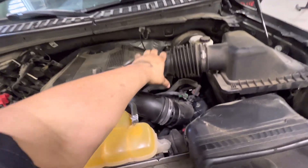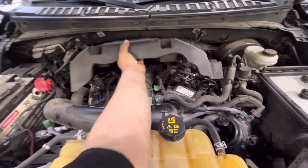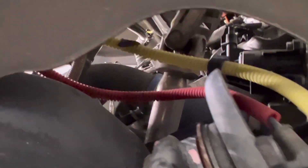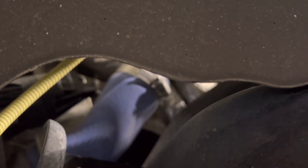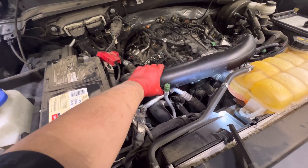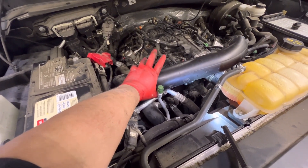Removing the upper portion of the air box first, then the engine cover. With the wheels off I'll be able to access the clamps to get from the intercooler piping to the turbos, starting with the passenger side turbo intake piping.